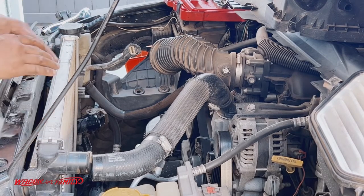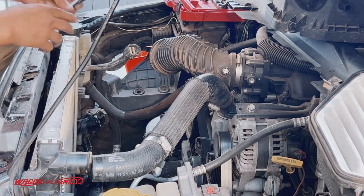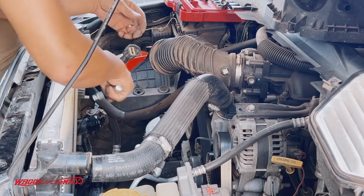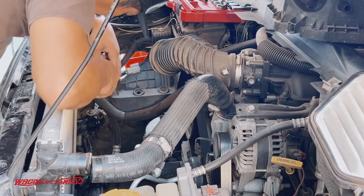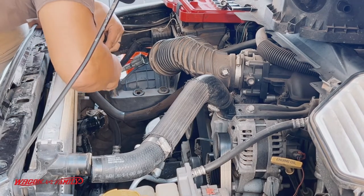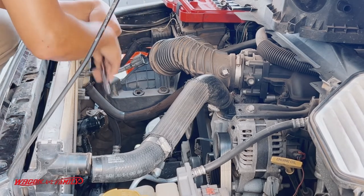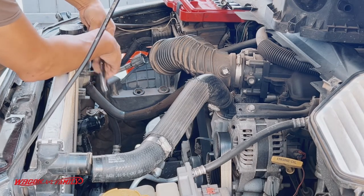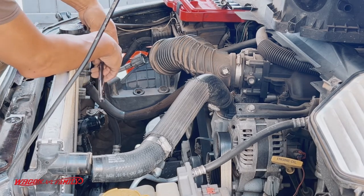Now that the radiator is exposed, I can see exactly where the leak is — right here on the driver's side in the middle of the radiator, a little pinhole. As the radiator heats up it gives off a kind of sweet smell. So if you're smelling something funny that's not oily — a sweet cotton candy kind of smell — that is your coolant leaking. It's a really good idea to understand what each fluid smells like. Differential fluid is probably the worst. Radiator and differential fluid definitely have their own unique smell you can't mistake.